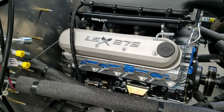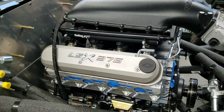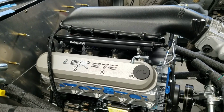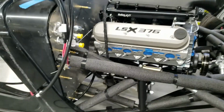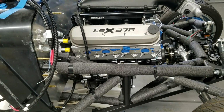And so it's not the easiest thing to do, lining up these pins and stuff like that as you're trying to get this thing adjusted. And these lifts stay tight, but if you leave them for an hour, the engine will drift half an inch or something. So I don't want to get stuck and leave it overnight and come in the next morning and the engine's way into the car when it should be where it was originally